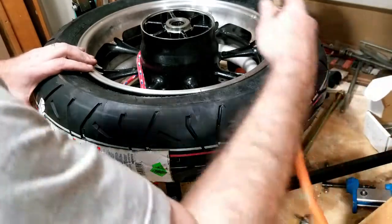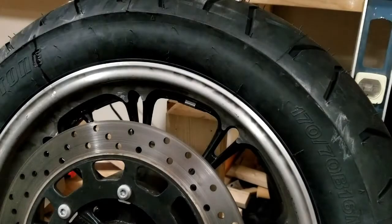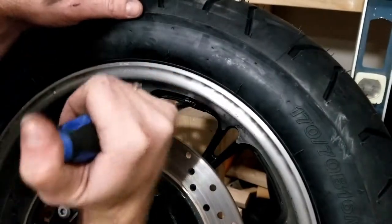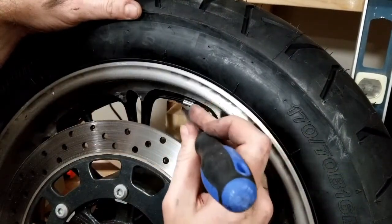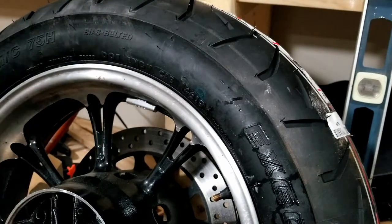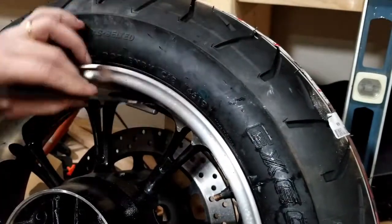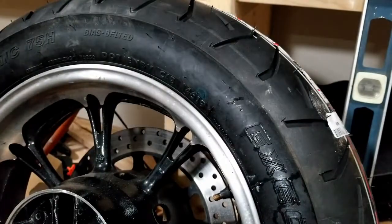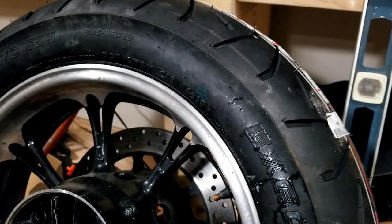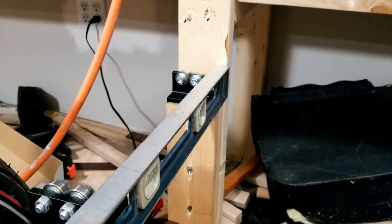This tire has a ridiculous amount of air in it now. We've got air in it to the pressure it's supposed to be. Next is taking this valve clip off — I'm going to try to do it without scratching the rims. These rims aren't perfect anyway. That's going to work just fine — came off no problem, just with a plastic tool. Let's get this up on our balance stand. Level looks good — give her a spin.